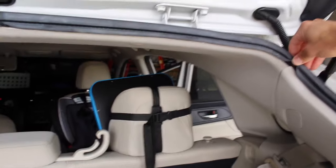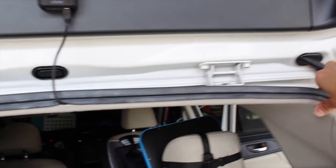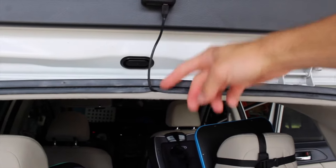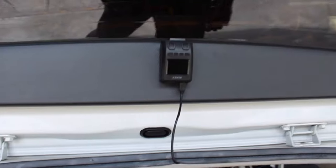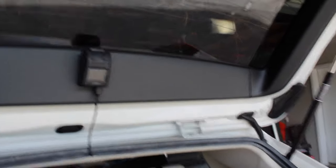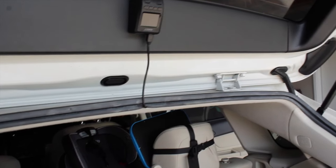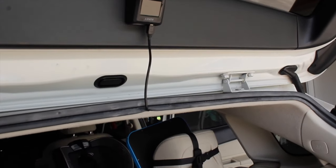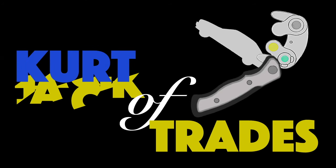Lastly, you're going to pull this rubber trim back, tuck it under the headliner, and go all the way to the dash cam. Make sure you have enough cable so that when you open the trunk it will not pull the wire at all. And that's pretty much how you do it — it's pretty simple. Just tuck it underneath the trim panels and try to remove as few pieces as possible while you're doing it.